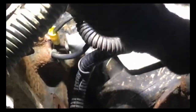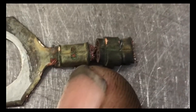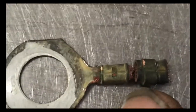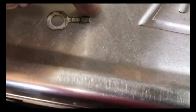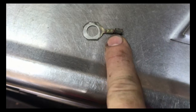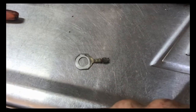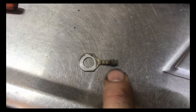The truck does start now. Here's a better look at the connector — you can see it's broken right in there and you can see the green corrosion. That was the problem. I saw somebody else online who said their truck wouldn't start and had no power on this wire, so they ran a ground up by the coil pack. The problem is, one wire comes in here and the other side runs here — if you jump it up top, you're still running through this broken connector back out to the other coil. That's not a proper fix because the other side could break too. It's better to go right to the source of the problem and repair it at the source.